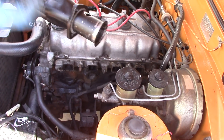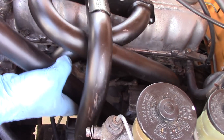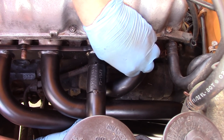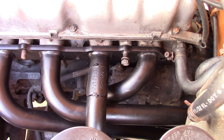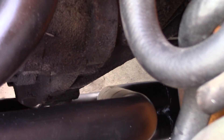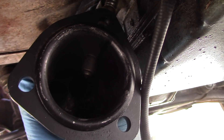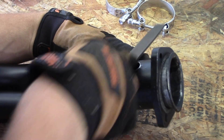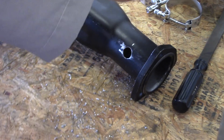Alright, back in with the exhaust manifold. Here's our O2 sensor in the header — that's where we drilled our little hole. It goes nicely up in there between the unibody and the engine. Now we'll put our little flange on there with our little clamps.